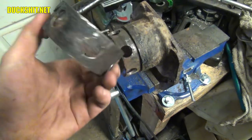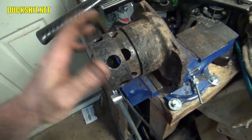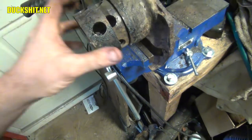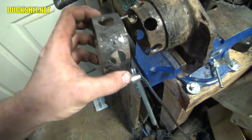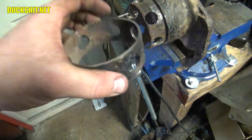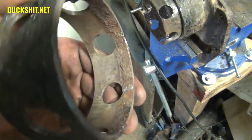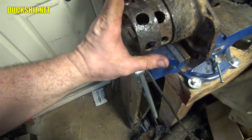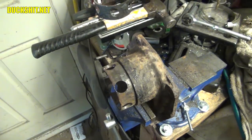Since this is the second attempt, I gotta say this turned out a lot better than the first side did. My cuts are a lot straighter, they're better placed — just everything about it was better. Again, thank you William for the hose clamp concept for marking a tube. The piece came off in one piece. I didn't have to split it or anything. It was a little hard to get off — I had to use a punch and a hammer, stuck it in one of the holes and knocked it until it came apart. It took a little while, just because of all the rust in there. You could just see the rust between the layers. It's pretty significant. These two pieces bonded themselves together pretty good. Let's go ahead and take it out to the bus and see how it turned out.